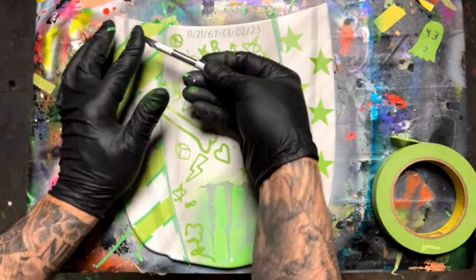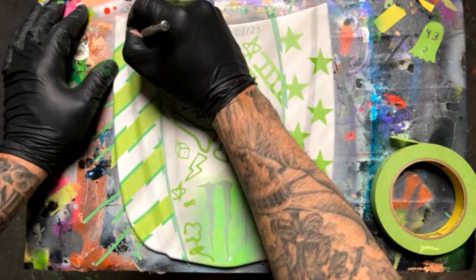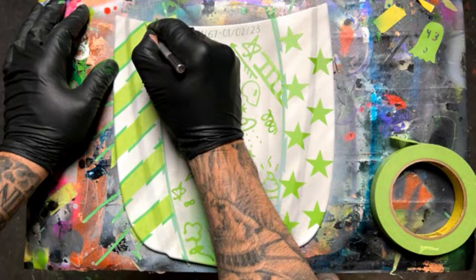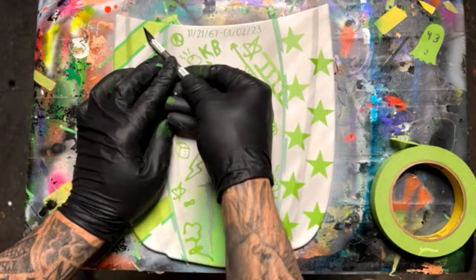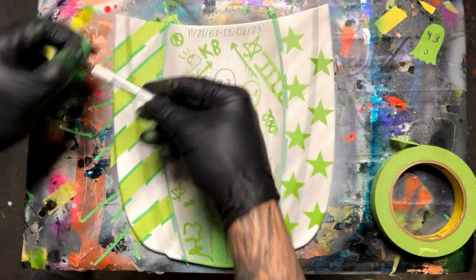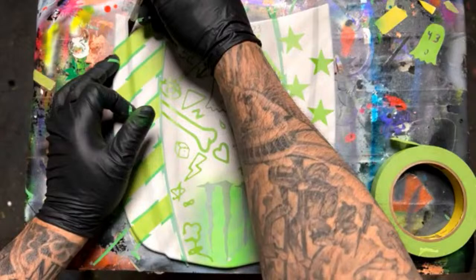Well, someone else asked, will base color affect the color shift powder performance, or do you recommend a certain color for the base? On the powdered pigments? I believe so. You can use any base you want on the pigments. If you start with a lighter base, like a white, it'll get brighter faster. But no, it shows up over black too. Yeah, even blacks, but it just takes more to cover over that. The thing with the pigments is they're meant to cover. Unless they're like the metallics, you can, once again, use them kind of like a pearl, and you can dust them over the top.